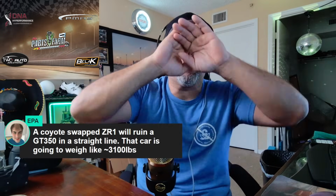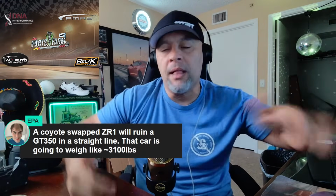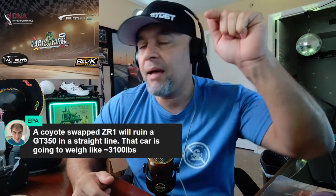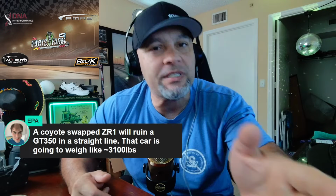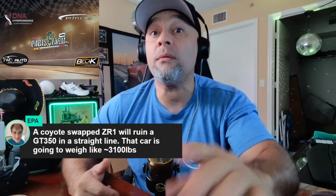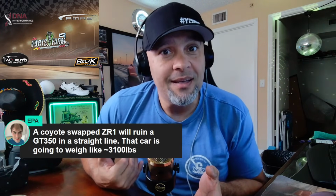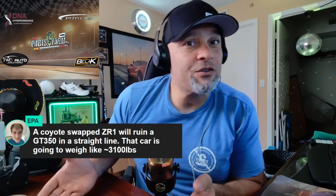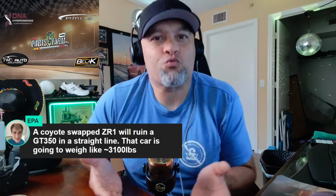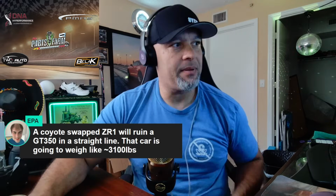Just shut off the Ford thing. Like, please stop thinking Ford, Coyote, blah, blah, blah. A 3,100 pound car that has 800 plus horsepower at about 14 PSI. Race gas, dual overhead cam, 11 to 1, 12. No, I got 12 to 1 compression in it. It's got Gen 2 heads. It's got Gen 2 cams. It's got Gen 3 bottom end. It's going to have a 2650 on top of it. It's going to have a 1700cc injector. What is wrong with that? Why would you hate on that if I can make it all work? Please stop.